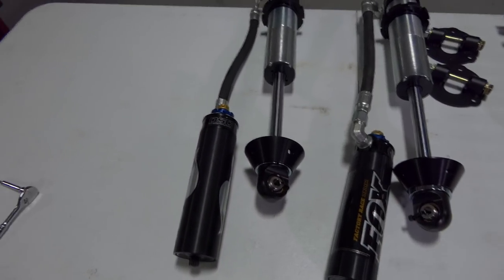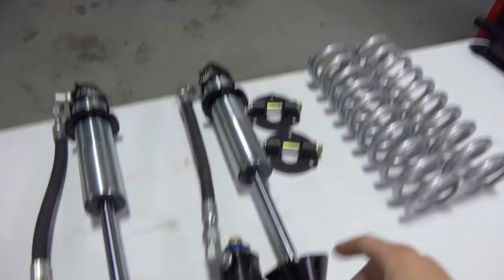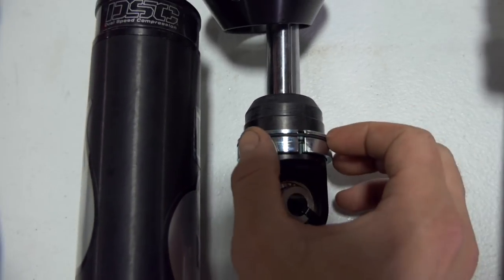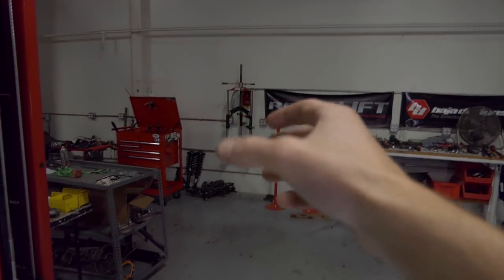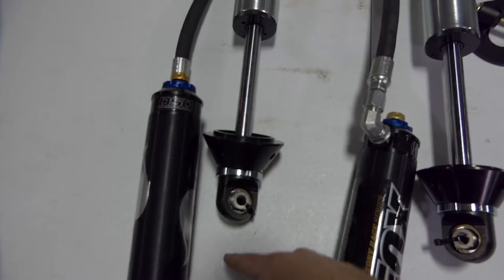One thing is, what we're going to do is put this over to the coil spring compressor. You're going to grab your coil spring and take off the O-ring right here that holds these clamshell pieces on. Those will pop off and this retainer piece will slide all the way off. Once that's done, you slide your coil spring on, and then you put it onto the spring compressor.